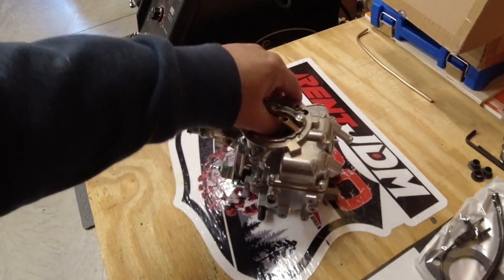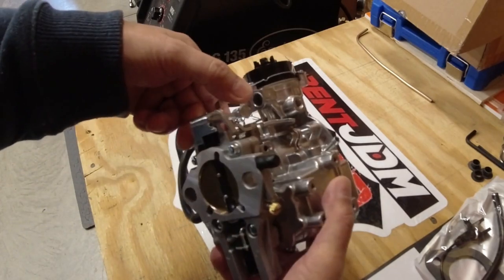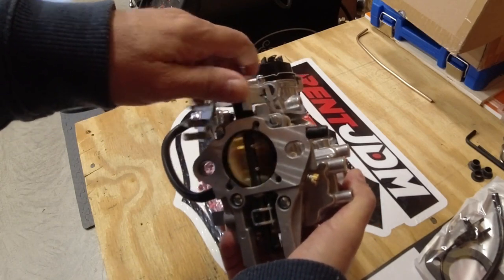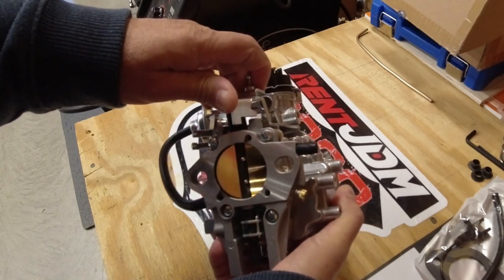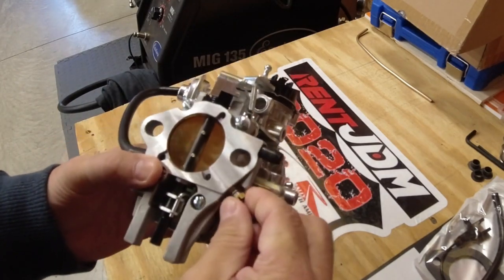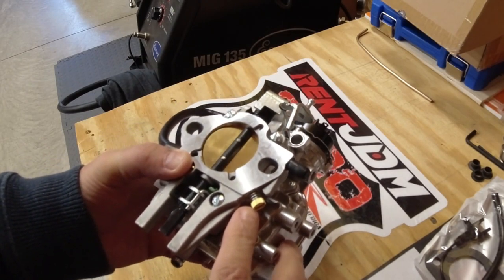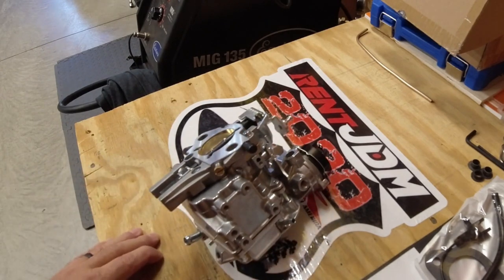The choke doesn't stick — that's nice. The throttle linkage seems to work okay, though the Maverick's throttle is never at the extremes; it's always somewhere in the middle. The air idle screw looks to be all the way in. I'm going to turn it all the way in, then back it out a turn and a half — that's the default for any idle air mixture. Then I'll get a vacuum gauge on it after I get the thing on and hopefully running.